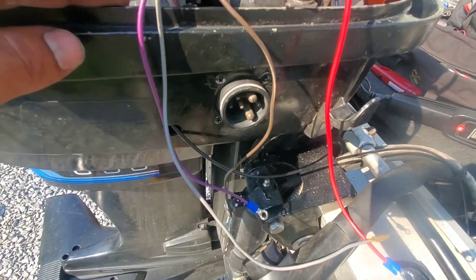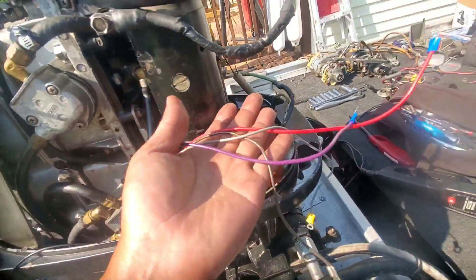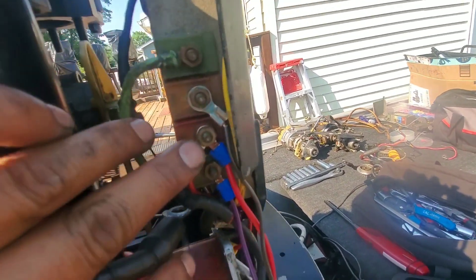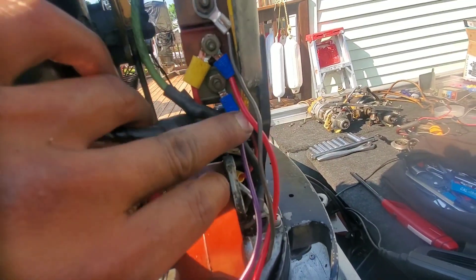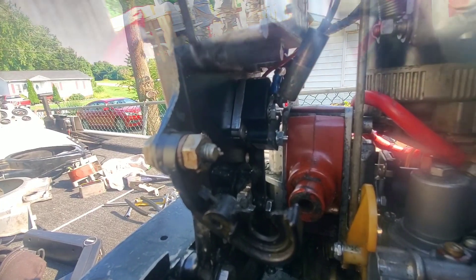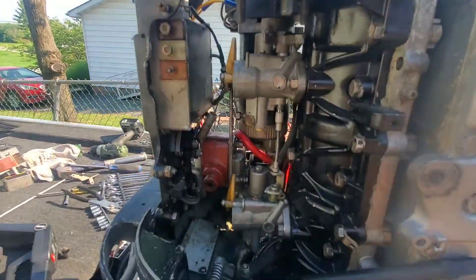Now I've got the new internal harness installed, everything bolted on, solenoid hooked up, starter hooked up. I'm going to put on the faceplate and connect all these wires. The faceplate is now installed, all the wires hooked up — that's from the coil, that's from the tach (which might end up being moved to the rectifier), this is the 12-volt also attached to the rectifier, this one goes back to the controls and into the battery, and then this is your run switch — the purple wire on the white. The switch box is grounded at the bottom by that screw. The rectifier barely fit, but everything's in there. Now I've got to hook the distributor up and connect these, do a little modification, and then we should be able to feed it gas.